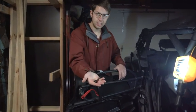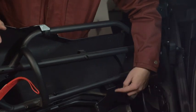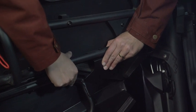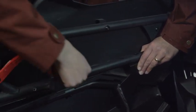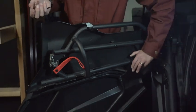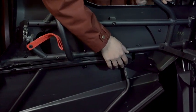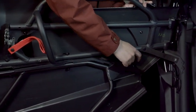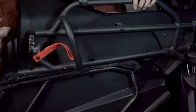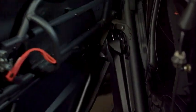Now we're going to be taking these to reattach the lower door to the upper portion of the door. One thing that's different from the front doors is this piece here — that's the piece we put the clip on, and it's going to slide under just like this, and we'll put a screw right through here. We'll put one on here and one on here, then start wiggling the door around to line it up correctly. There's already a clip that comes on the Can-Am door, so make sure you line it up correctly with that clip. Slide it around to get it lined up correctly with the curve in the door right here, and get everything nice and snug.